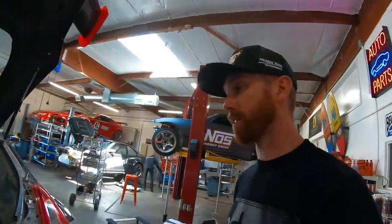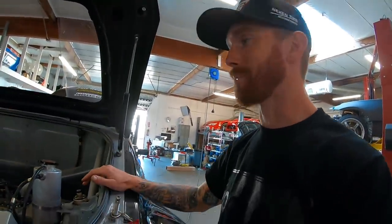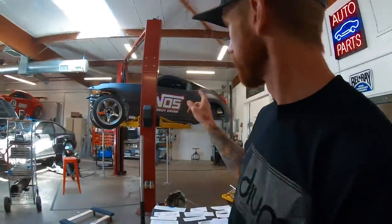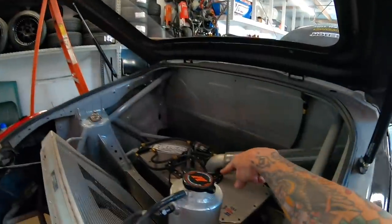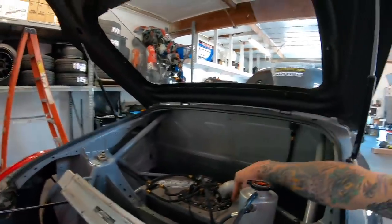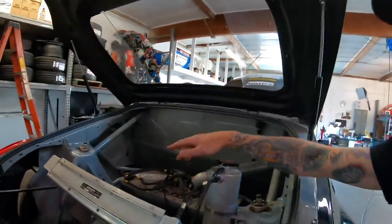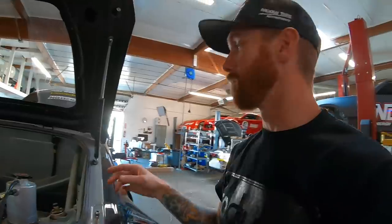The only thing I really love about this car is it was actually the first rear-mount radiator car we ever built — built with Brian at MA Motorsports. It's a little different layout than what we do now, but it's funny because we're going full circle. At first we thought there was too much weight towards the front and not enough in the back. On the race car we started moving everything really far back, it got too much weight in the rear, and now we're moving things back around to even it out. On this car the fuel cell is on the front side of the big support we're not allowed to cut per the rules — ideally I'd have it straddling the center but we can't. The oil tanks, nitrous bottles, and radiator are all positioned back here. We used to have a big scoop that went up to the window but it blocked all the cool fab work so we took it out.